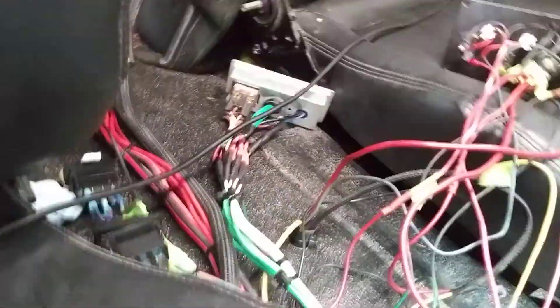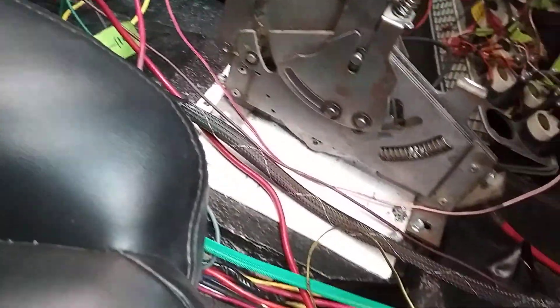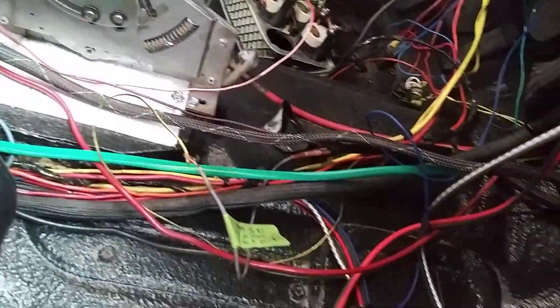So I'm going to have to run a little circuit for it. I just want to give you guys an update and let you see the wiring over here. It's pretty much all the wiring that I'm going to have running — just about half of what it was running before. The fuel rail got replaced; it had non-rated injector fittings that were leaking and putting air into the system. We got all that figured out.